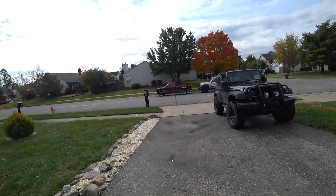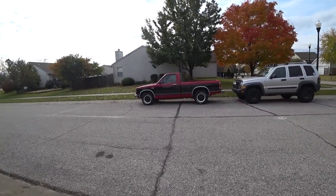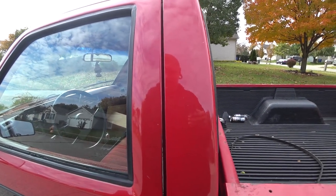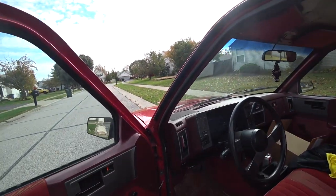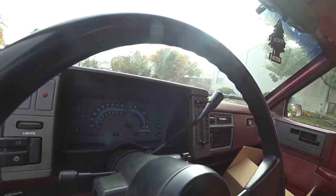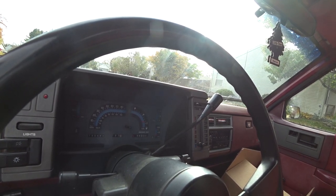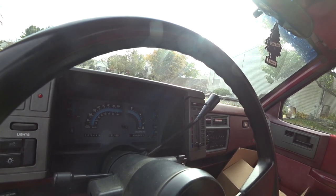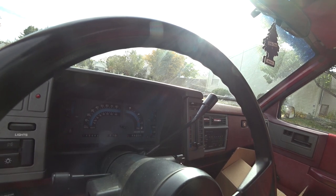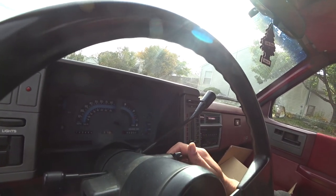It is somewhat of a task right now. The first thing is to move all of the other project vehicles around, but the truck isn't wanting to run all that well anymore after I've added the larger throttle body and quite a bit of other miscellaneous sensors and electronics. The truck still runs, it drives and everything, but it does seem to be lacking power, running really rich, and it doesn't want to idle. I've already gone through all of the normal things — air idle control, throttle positioning sensor, coolant temp sensor — and come to find out it's most likely that chip inside the computer. Let's see if I can just turn the key and start it.